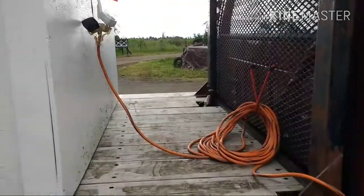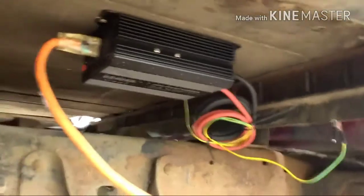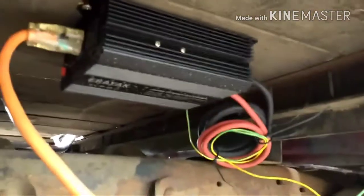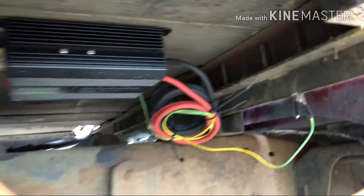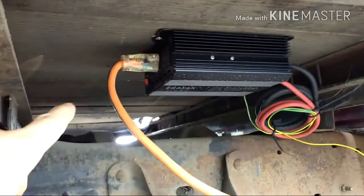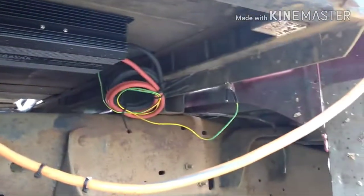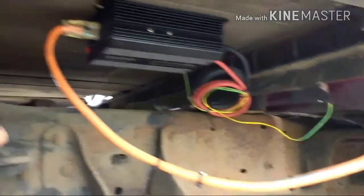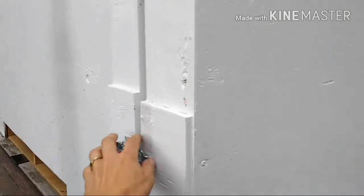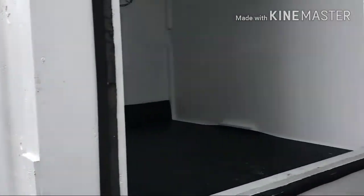For the power, there is an inverter — the inverter box is off right now — but there's an inverter down here that turns the 12-volt current from the truck into 120, and then we just plug in the extension cord here. There's also a breaker on the battery so that way we don't fry these wires here if there's a malfunction. We use these latches from Amazon to hold it closed.